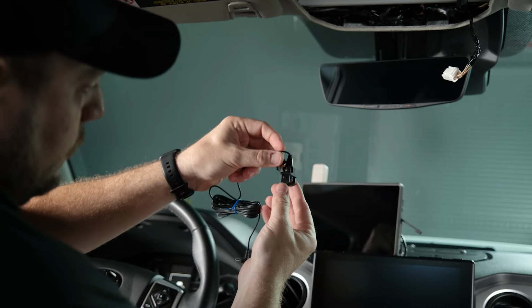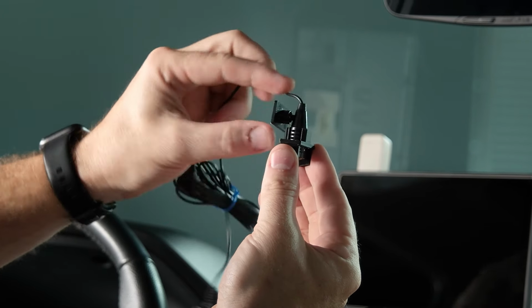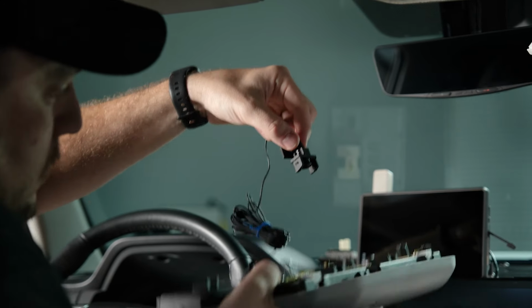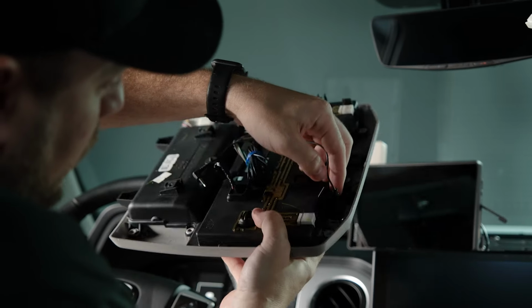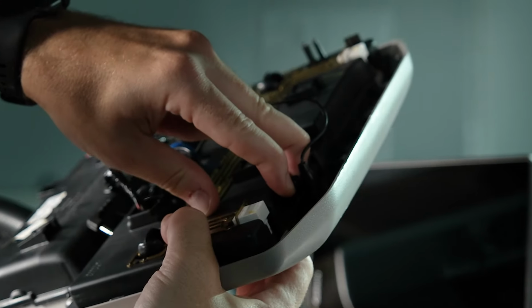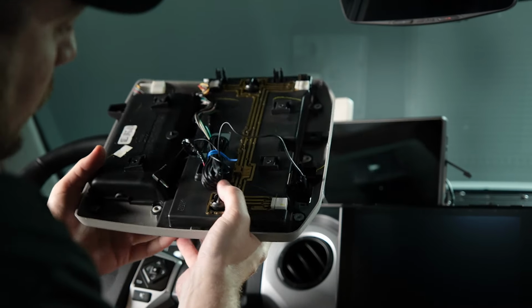So what we want to do is position that. Here's the cut off edge, and then we're going to rotate the pedestal to where it's going long ways there. So at this point we can peel off the other side of the paper. We'll grab the microphone by the top there, and we're just going to press it right down into the headliner console, and that Sony mic mount will lock into place. And then we can adjust our microphone, and then we'll give the 3M tape a good stick to the side there. So you guys can see that is not going anywhere, fits in there perfectly.